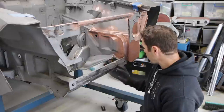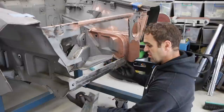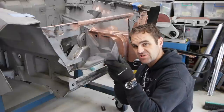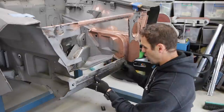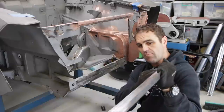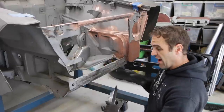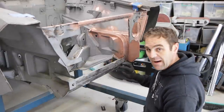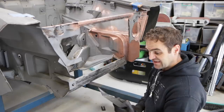I've tidied everything up and got this lower square tubing piece in here loosely where I wanted it, and I made up this connection piece. Basically what this is - it's just a strip of sheet steel that I'm going to weld onto here like this, because this lower edge will actually weld onto the bottom of the nose cone. That's the way I'm going to lay it all out. Now it's time to make sure this is perfectly even, weld this lower bar in, and then I'll show you how I'm going to get it all lined up and get it on the car.